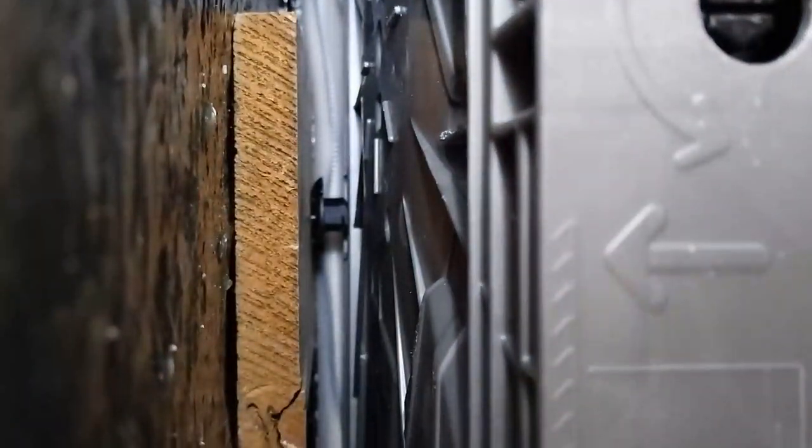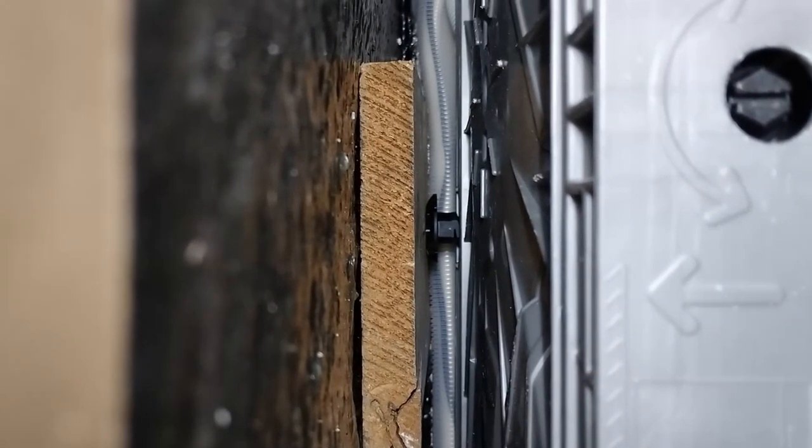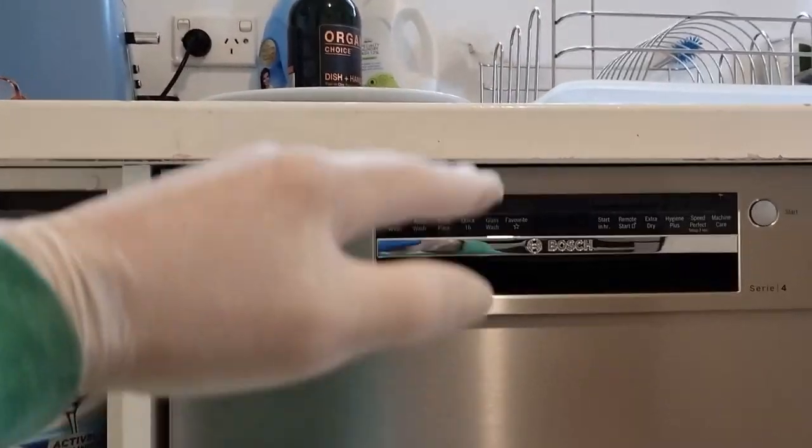With the dishwasher nearly installed, we can see underneath — maybe able to see the leg right at the back in the middle there. As we look on both sides, the front adjustment screws are adjusted. All this is clockwise — clockwise to put this down and clockwise to wind the back leg down — so at the top it's been adjusted up.